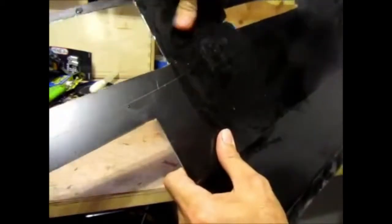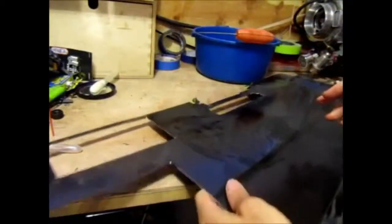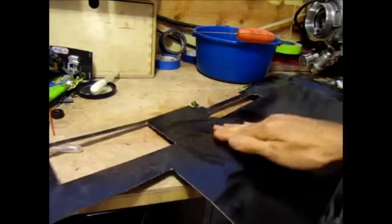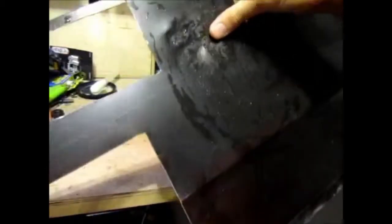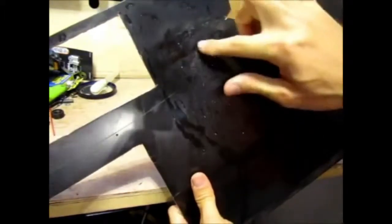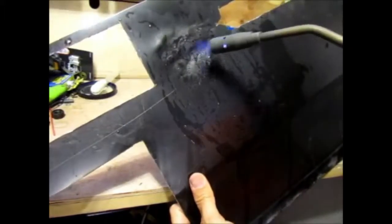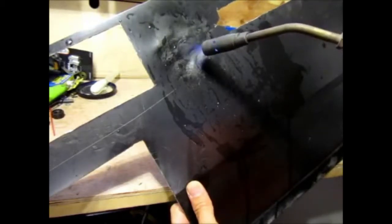Okay, doesn't flex. Now sometimes, and this is why I said you want to use the hammer, you can actually fix a dent using the heating and cooling method. Well, you probably can't see, but there's a dimple on the back side going towards the inside. So what I do to fix that is basically just heat it up again, right at where you want to hammer.